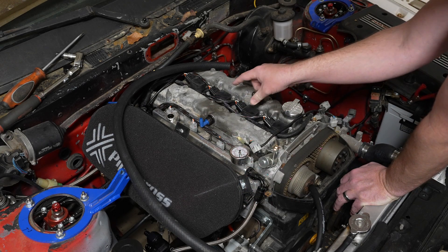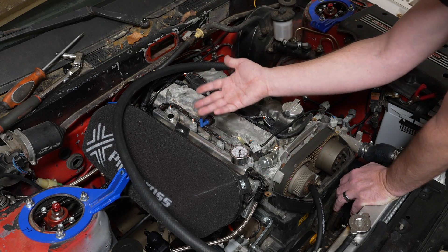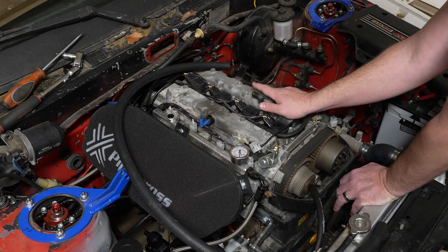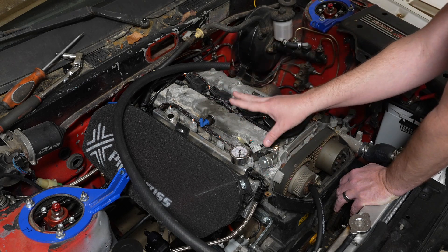Because as we're pulling a vacuum on this and pulling air in here, if we leave it open it's just a massive vacuum leak — the same as leaving that port open on the intake manifold. By putting it to the mass airflow sensor, it is now a metered air source to the engine. This is important because a lot of people will just disconnect that or put a little breather filter on it, and their car never runs 100% on a stock ECU because they leave it open to atmosphere. The proper setup is: PCV to the intake manifold, and the fresh air vent back to the intake after the mass airflow sensor and before the throttle body.